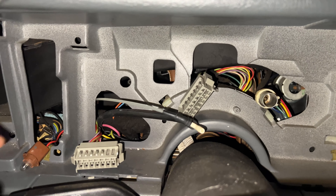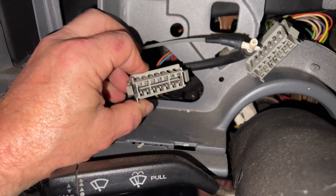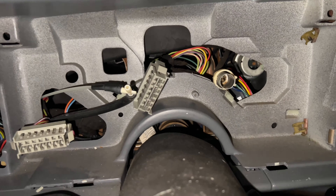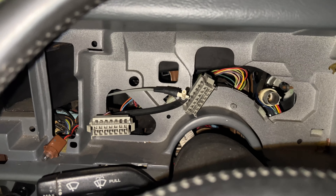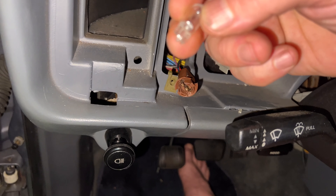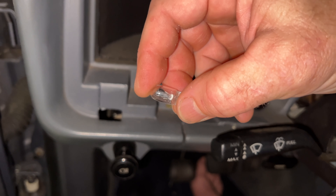This was super tough to get into because the wiring is not long enough to pull the gauge cluster forward so you can easily get your arm in there — I've torn my arm up getting in there. Since this is an SVO Mustang it's got a turbo, so this is the boost gauge connection. Here are the connectors that you've got to squeeze together — those were tough to get to because of the tightness behind the dash. And then here's the speedometer: you've got to push that little clip to the side and that releases it and it'll pull straight out. It's going to be fun getting it back in. Now here's the over-boost warning light — I'm going to pull this bulb out and test it because it didn't come on with the key on, and run an ohmmeter across that to see if the bulb is still good.